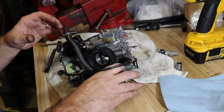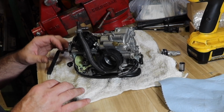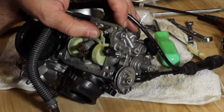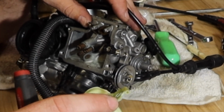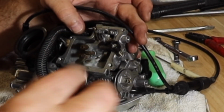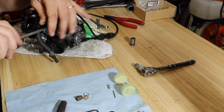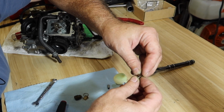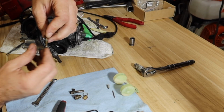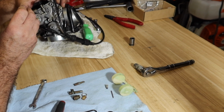I have a really strong feeling that we don't want to put those Welch plugs in yet, because if there's any differences in these passages, it's going to cause it to run a lot different. Let's get this other side uninstalled. Oh, that needle came out okay. Okay. There's my seat gasket, and the filter did not come out. My filter, jet, star 105S. I think the other one said 108. Let's count the turns on this one. Half, 1.5, literally just over 1.5.